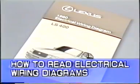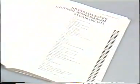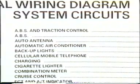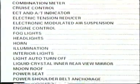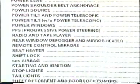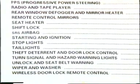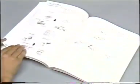Next, we'll see how to read the electrical wiring diagrams for the LS400. Suppose you wish to inspect the SRS airbag system. First, look at the items under the heading System Circuits, and look for the item SRS airbag. On the page indicated, you'll find special precautions about checking the airbag system, as well as the circuit diagram for that system.